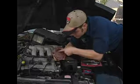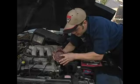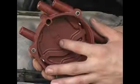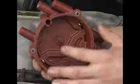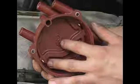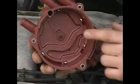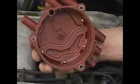It runs through solid state into this spring-loaded connection here. They need to be checked for tension. Sometimes these springs will seize in a retracted position. That will ruin your contact. It'll cause arcing between the button and the rotor.